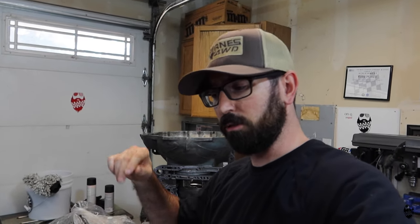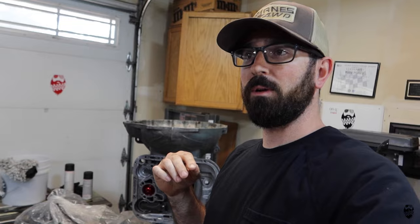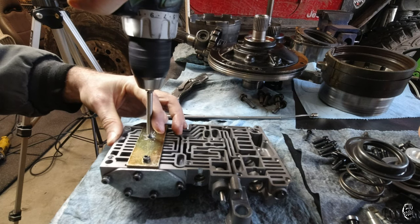My buddy, who I used to work with at GM at the dealership, went on after I left and is now a master automatic transmission tech, ASE certified, GM master certified, all that stuff. So he came over and we went through the whole transmission, looked at everything, tested a bunch of stuff, and basically came to the same conclusion that neither of us knew what the problem was. Basically, everything seems to be coming back to the Transgo TF3 shift kit that I installed in the valve body. Like I said, we didn't see anything necessarily wrong with it, but obviously there is no fluid getting through the passages in the correct way to that front servo when I shift it into second gear.